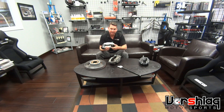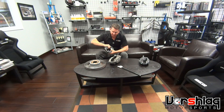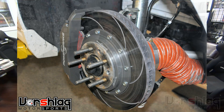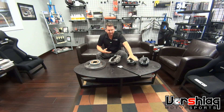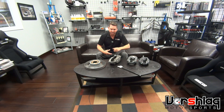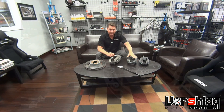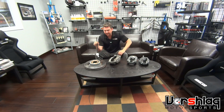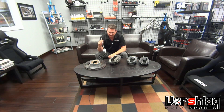There are still improvements to be had by going to a real motorsports caliper and a real two-piece rotor — we've tested that on S197s and it's a big improvement. Their 350mm six-piston kit works really, really well. I can't wait to try the 380mm experimental kit on our S550 in the coming weeks. But again, this rotor — directly from the engineer that designed the system — should never be used in a track car. And I mean never. That's from the guy that designed it.